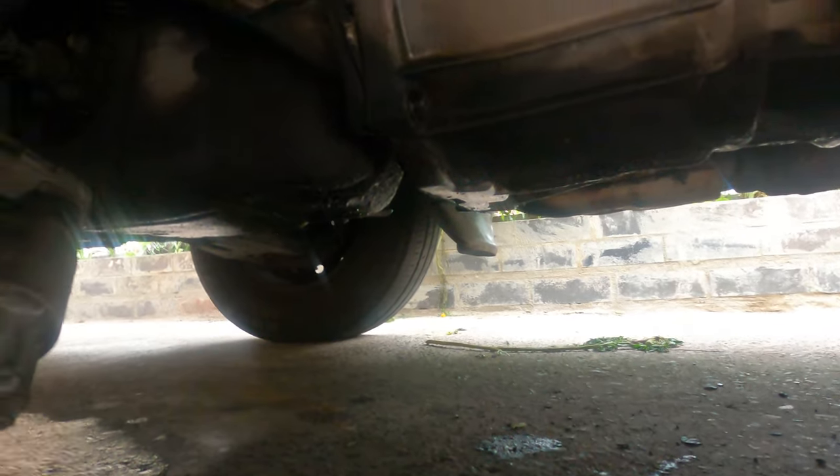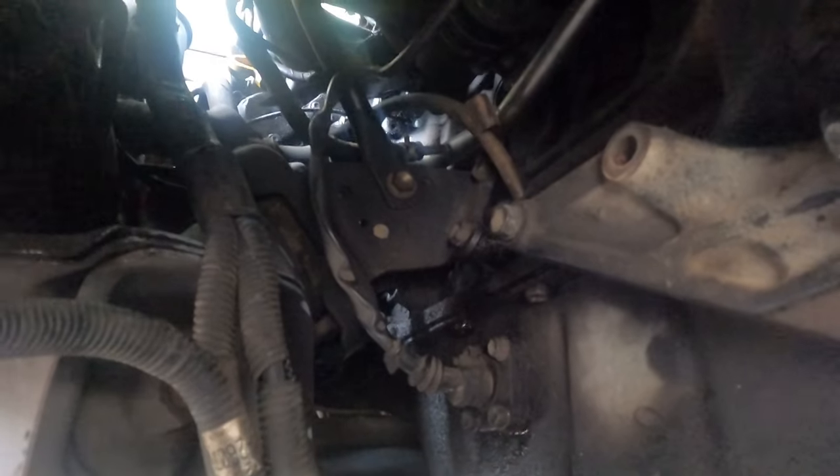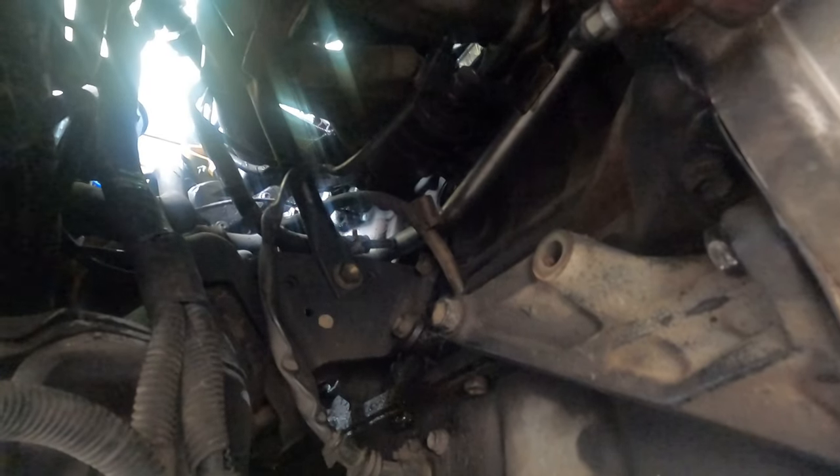All I have to do is go underneath and use this one, it's called the plastic pliers. I take off the starter motor again, so I have to enter my hand in here. It's only one way to go. You squeeze this one, see the input wire. Squeeze it like that, and you can start to undo it from there. And that's it. That's how you replace your fuel filter. You need one of them to stop the fuel coming out, and then you can remove it. Out, it's loose, so now we can move it out.